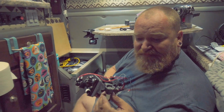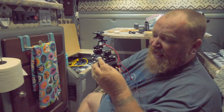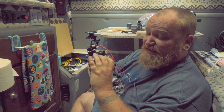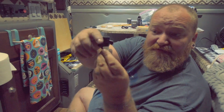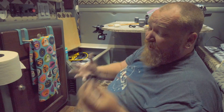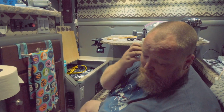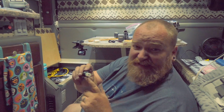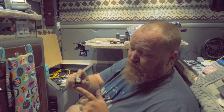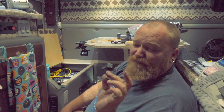One tip I want to mention, the pump comes with these connectors. This is a barbed fitting that your water line can fit over, and it makes it quite easy to install because these twist freely from the actual barb fitting. So with the water hose on it, I could twist this on there and put it on. Problem being, this is cheap plastic. The ones that Bolt did put on there, and I'll give them props for this one, are metal fittings. It gets cold back there in the winter. If I use these they would end up busting or freezing, so I'm gonna stick with what Bolt put on there, the metal plumbing fittings. Just a quick tip, these do make it easier to install, but there's a big chance of them busting in freezing temperatures, so don't use those.